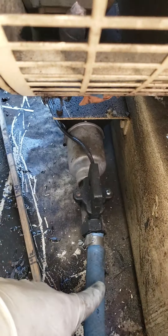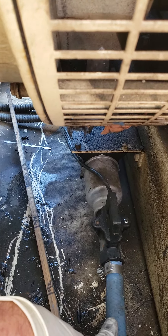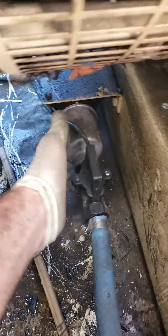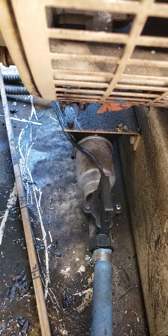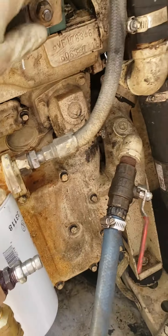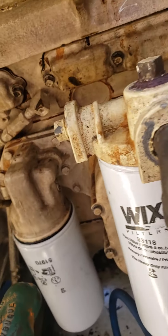I finished last night — actually five in the morning I finished — but I had to come back because I had to warm it up. All backup systems have what's called a primer water pump and a water heater, and that's what this thing is. This one's 120 volts; usually they're about 120, some are 240 — they're never 12 volts though. So it's been pumping all night and now it's quite hot to the touch. It's hot in the manifold, and they've got water running through the head. Now we're good to go.